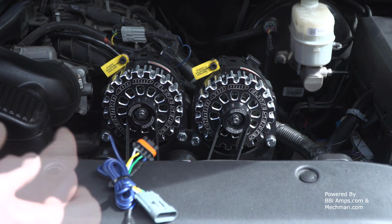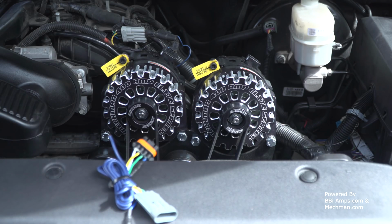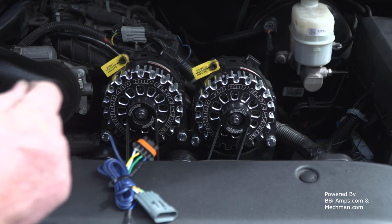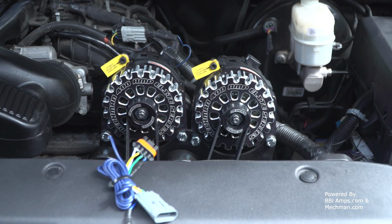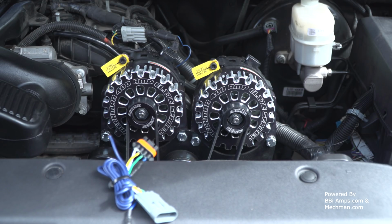So I attached the white lead to it, had 0 signal. Boop, shut off the dash charge light. You can jumper the brown and white together and have it touched to the switch source. That'll temporarily fool the computer into thinking that you have overridden, or that the alternator is okay. What it's really looking for is a low voltage signal source to pass through the alternator itself.